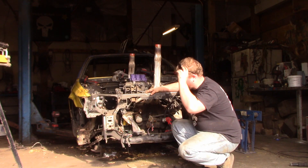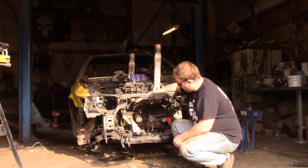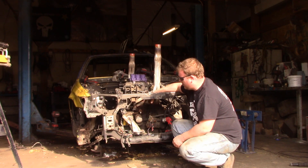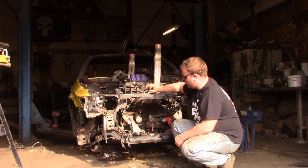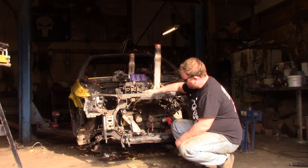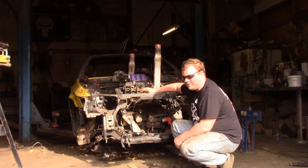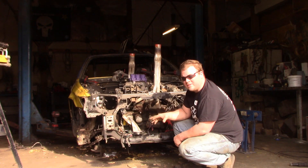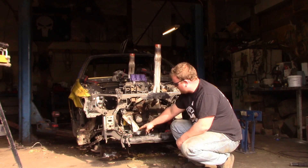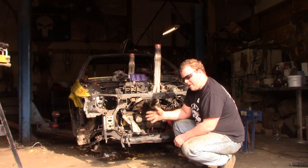I've contacted a couple promoters here in Ontario and they told me they do not like my big motor mount that I build at the front because it doesn't go to the factory Toyota Camry mount location. He told me if I'm able to make my mounts go from the block to the factory mounts I'm allowed to do it. So I built this one up front — it has a plate to go where the air conditioner used to be and then it zigzags over to the factory Toyota Camry mount.